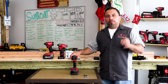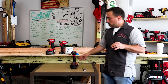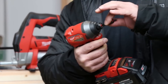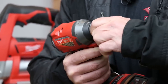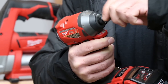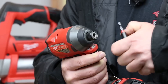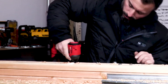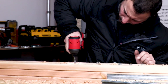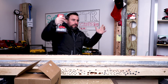If this is your first time here, you might not know — in previous videos, we talked about the collet on our fuel line of impact drivers from Milwaukee in their M18 line, and how they affect generation two and three. The issue is that the collet, when you're placing pulling force on the tool to extract a bit — or any type of force to pull back on the tool while having it under load and it's impacting in reverse — the bit will let go.